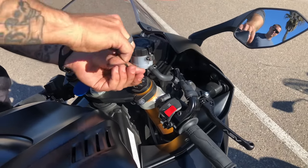So to recap: when you look at a bike, understand preload — think of blowing air into an air mattress. More preload means less sag when you sit on it; less preload means more sag. You want it to sag about a third of the way. For rebound, all you're doing is restricting the oil flow with a needle. That's exactly how you test and set rebound. After many thousands of miles, the oil wears thinner and behavior changes — change the fork oil. If you buy a used bike, ask if the suspension was ever serviced. Go read Total Control, Second Edition by Lee Parks. Thanks for watching.